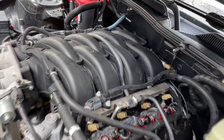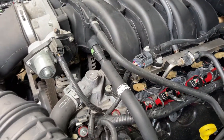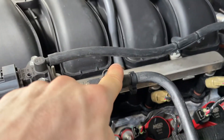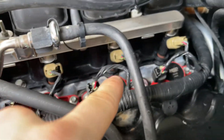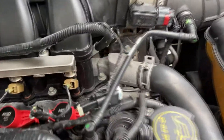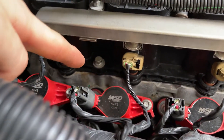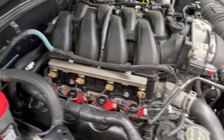Same deal from the passenger side to the driver's side — this is your crossover, it all comes over. Then you're ready to take the intake bolts off. These are all 10 millimeter. You have one there, one there, one in the center where the crossover is — look down through that hole and you'll see it — then one right there, one back up in there, and the same on the other side: 10 millimeter all the way around.